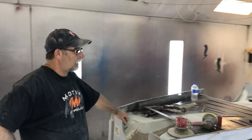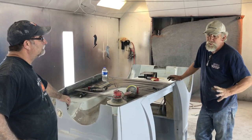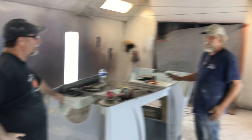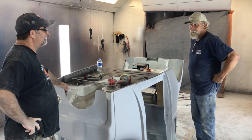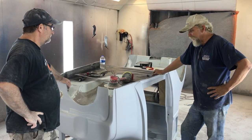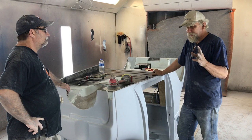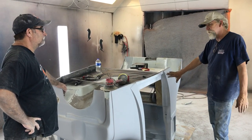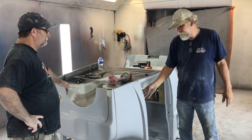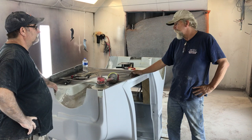This is the never-ending question — there is no good answer. Whenever you're painting a complete car like this, where do you paint first? You paint it with the doors on or the parts off? You paint the dash first, the top first? How do we get it all at one time? We've had that discussion going on for quite a while. There's not one right way to do it — multiple good ways. On a black car you don't have the issues you do with a high metallic car. On a high metallic car, the way the metallic stands on the face and on the cloth, you probably want to hang your doors first. That way when you paint the whole side, you'll have the same metallic look.